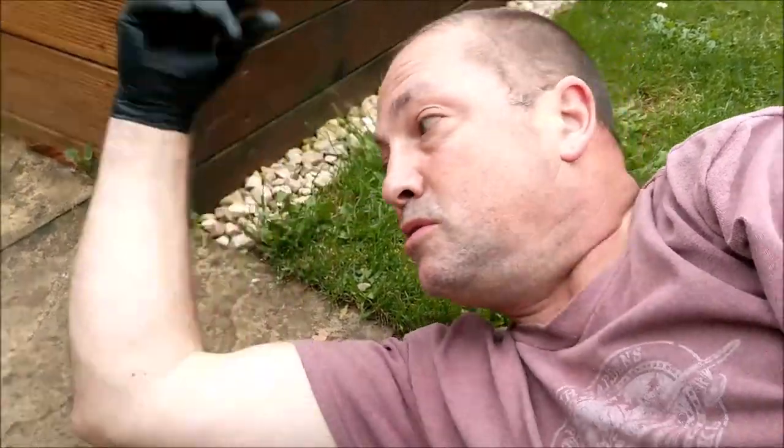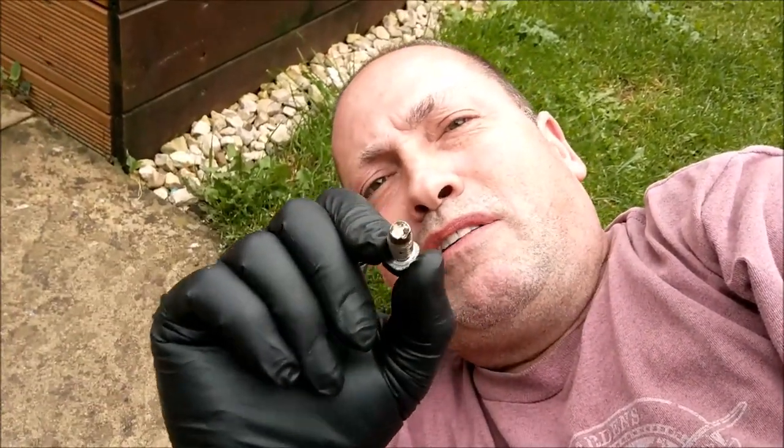So yeah, that bolt, that damage shouldn't be on there. If yours is clear, it's fine. I think they changed it on the, don't quote me on this, you can check with Suzuki. I think it was the 2012 bikes onwards that they changed to the newer bolt, and it made this one obsolete. So please do check your bolt. It literally takes 2 minutes to get the panel off, 30 seconds to whip the bolt out. You could have it out and back in and the fairing back on within 5 minutes, I reckon. Okay, right, catch you later, guys.